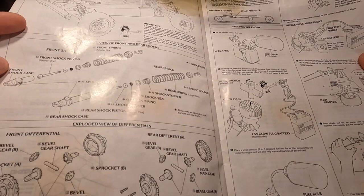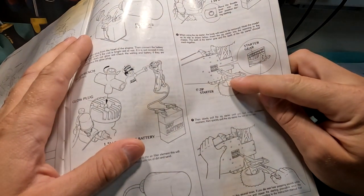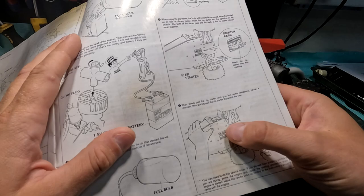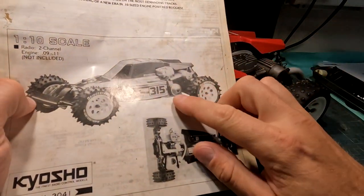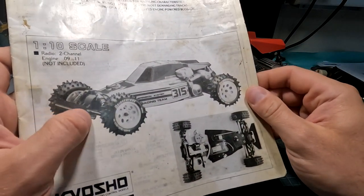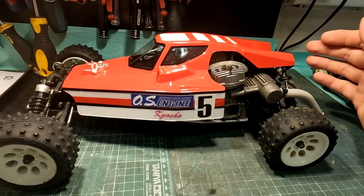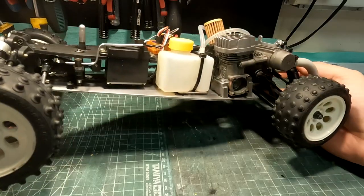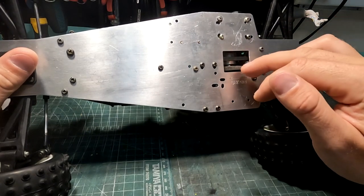The shocks are also different between Mark 1 and Mark 2. In Mark 1, you need to use this zip starter, where you pull the flywheel. There is a small ratchet gear on the flywheel. This Mark 1 also has this disc, which is used to start the engine with an airplane propeller starter. In my case, this Mark 2 model with a Mark 1 body does not have any starter — it must be started using the bump starter and the starter box on the flywheel.